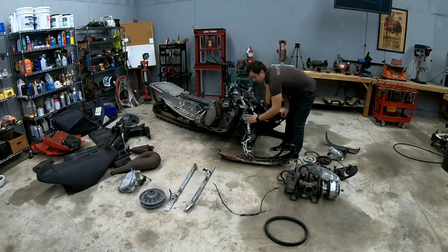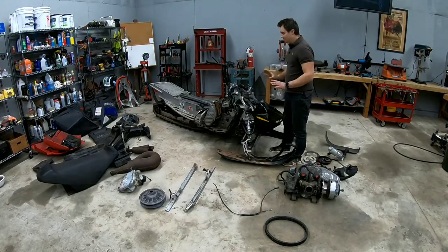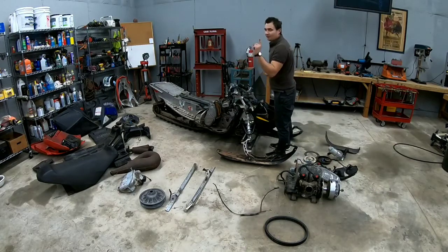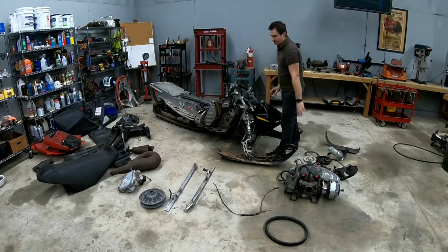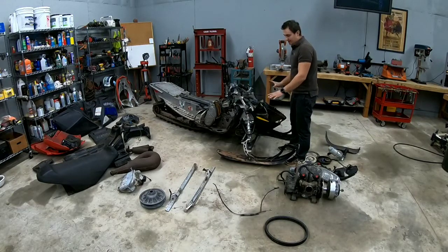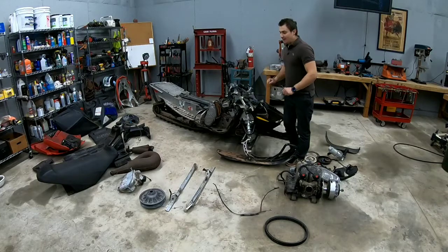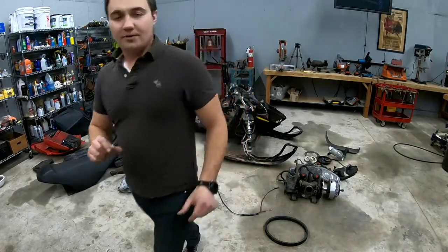For the most part this is pretty similar to an ATV — you got the upper control arm, lower control arm, shock, steering rack, steering wheel shaft, steering wheel, and throttle. One major difference is it only has one brake, with one caliper responsible for one disc that stops the whole track. The front has no brakes because it's skis — that's a very big difference. A quad has brakes in the front, which is very important. In this case the track is very big, so when it brakes with the track it's very effective.